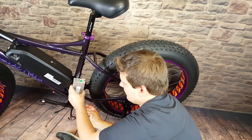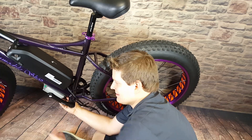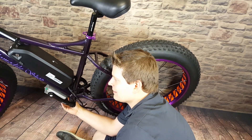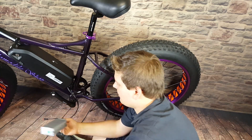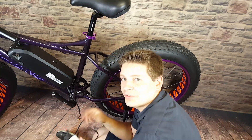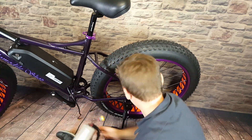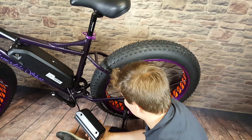You could create a little mounting bracket and put it here, or put it down here on the frame. This is a good spot because you have lots of airflow — it'll keep it cool — and in higher powered applications that makes a lot of sense. But it's a pretty mild 750 watt setup we're going to have here, so we're going to put the box onto the frame. I know that looks tight, but it will fit, believe it or not.